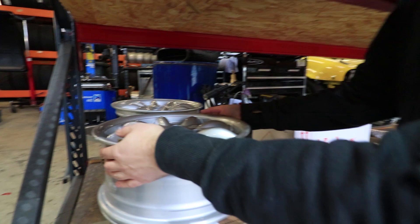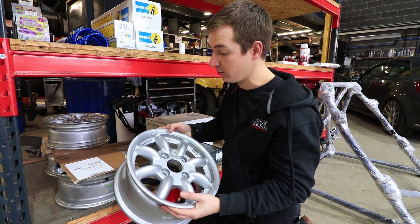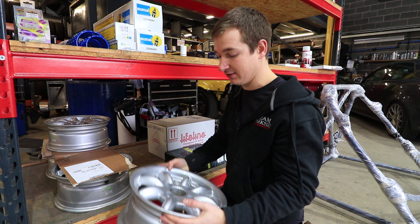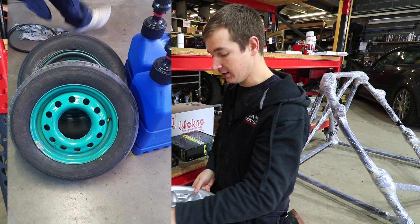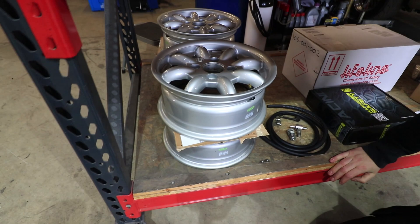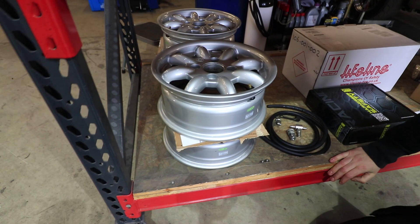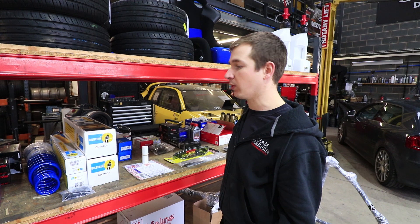These wheels are made by Compomotive — some used ones as the new ones haven't come into the country yet. We get these from Grays Motorsport, who are the sole supplier for these wheels in this series. The reason we've had to go to Compomotives is that the steel wheels are literally just ripping the centres clean out because of fatigue — they're old and you're putting them through a lot. This is a proper motorsport wheel. The roll cage and quite a few of the other bits come from Burton Power, our main sponsors.